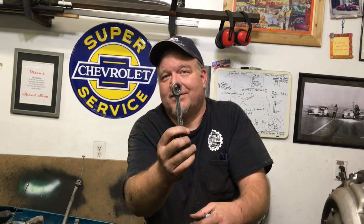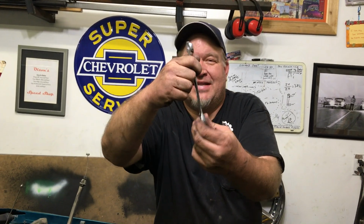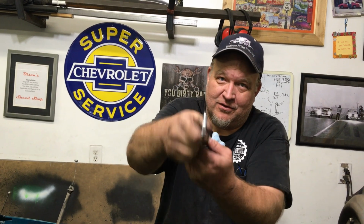Now you gotta watch out because you're gonna go to a point. If you look at this gear wrench, if you want to go the opposite direction, you flip it over. So I don't have the lever. Sometimes you can really hose yourself doing that. If you're pulling that bolt out and you get it up against that firewall, you are hosed if you can't get the bolt all the way out, because you cannot reverse it to move it back in. And if you go back in, it's not going to work. So be aware of that. But uses up these ones.